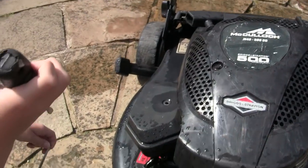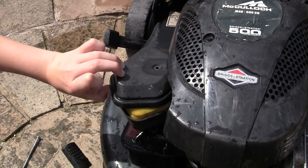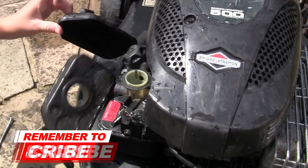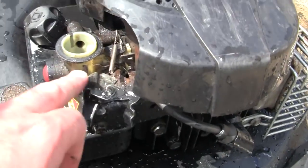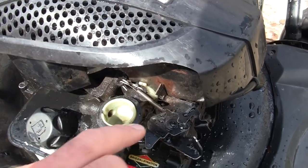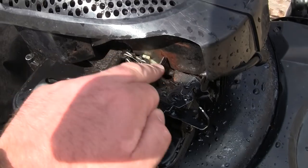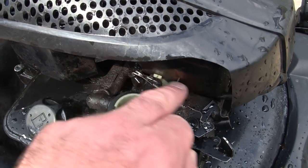That off there, that's right. I'm going to have to lift this air filter up. Sneak it off there, like that. Watch out. Right, look at these springs here. See this spring? Let me go around this side and show everybody. So as you can see, another classic case of these governor springs, actually a full spring that should go across to here that's completely missing.